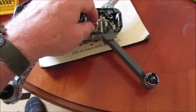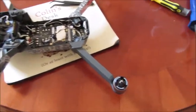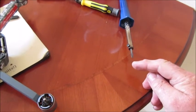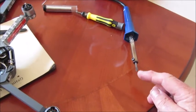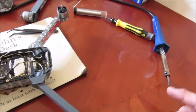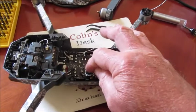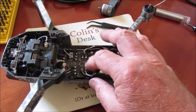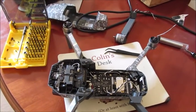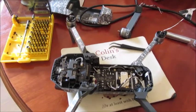It only took a couple of minutes. The soldering iron is not the best — I think it's a six pound Jablot special, not brilliant. It's important to get a decent one because you want the heat to come up straight away, and this one took a few seconds more than needed. Anyway, I'll just assemble everything back together and check it all.